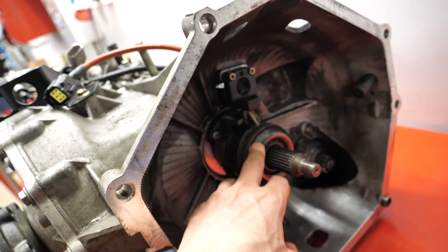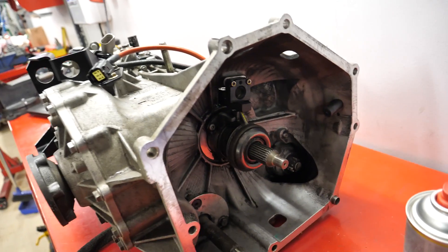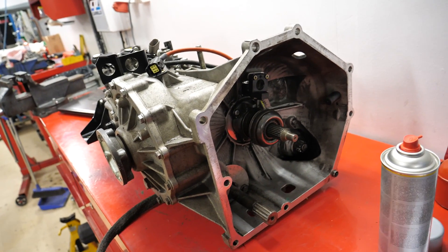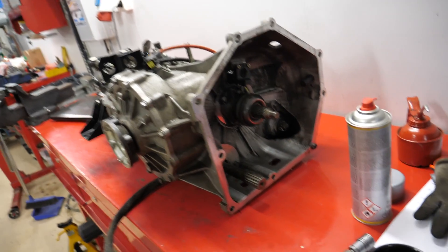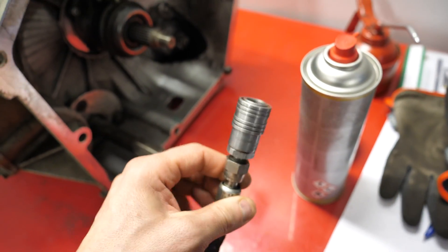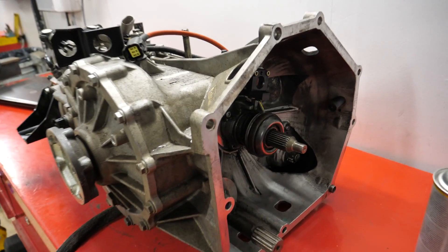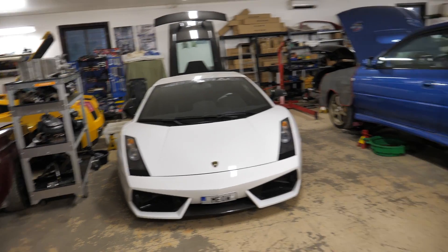The e-gear hydraulic fluid is different from clutch/brake fluid, and I'm not sure if the seals are compatible, so I don't want it to leak later on. Also, when pressing the clutch quickly I felt some resistance, and when side-stepping the clutch it was a little slow to release — I think there may be a restriction in the quick-disconnect fitting or in the throwout bearing itself. Normal driving is fine, but for quick shifts there could be a delay, so I need to investigate and resolve that.